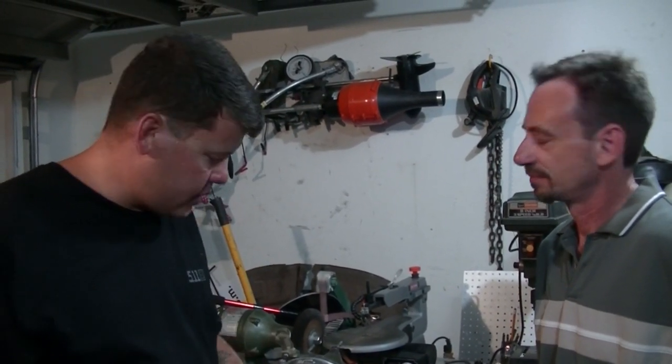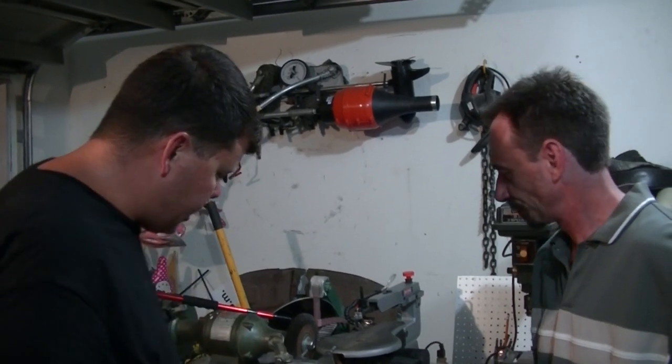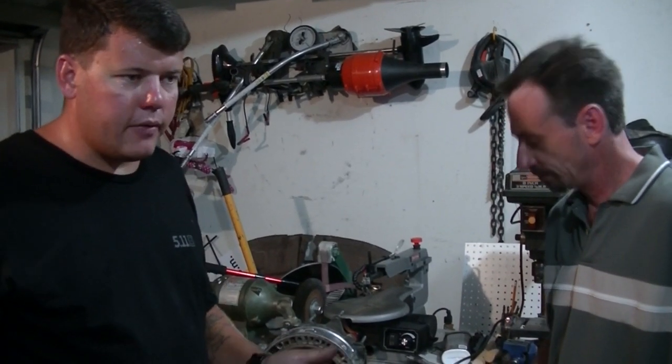If you let a rotary sit for a while, especially carbureted, with the gas that we have now, as you know, ethanol, in the small engine world you end up with what looks like powdered corn in places that you don't want it. So I run 100% gasoline. I run it at 87. Here in Florida, it costs me, I believe, about $3.45 a gallon.